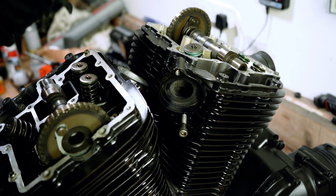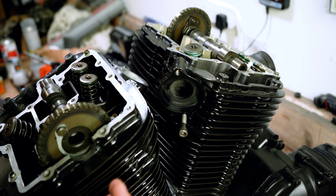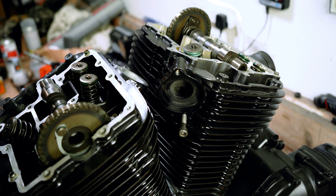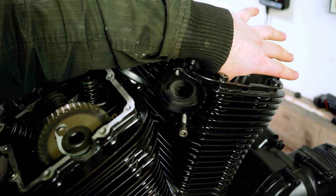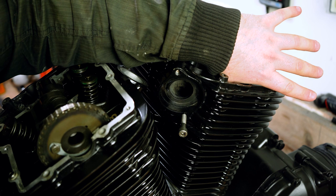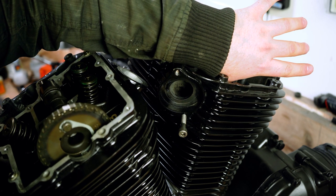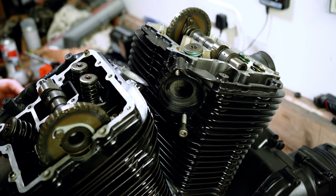The cams and the chain and everything is already reassembled on my engine. This whole TDC thing was an afterthought — I completely bypassed it when I was putting together the timing structure, which was just a big no-no. The easiest way to find the compression stroke is simply to place your finger or thumb over the hole of the rear spark plug, and then continue to turn over the engine with your socket. Keep that thumb pushed down. It really is as simple as waiting for pressure to push past your thumb. Once air comes past, we know that we're on the compression stroke.